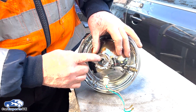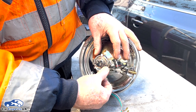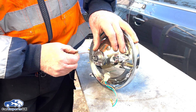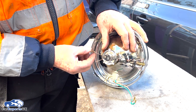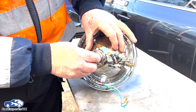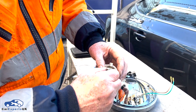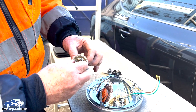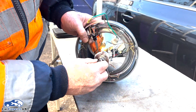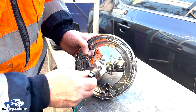And you can see the bulb now — three pins. Most bulbs are held in with a spring like this. This one's only got one tab which you push and it hooks out of there, and you lift it and it comes out and opens like a gate. Watch you don't drop this clip — sometimes it can be loose and fall inside the headlight, so be very careful that doesn't happen. Take the bulb out and you can see what position the bulb's in. You've got three pins on this to help it locate — it'll only go one way.